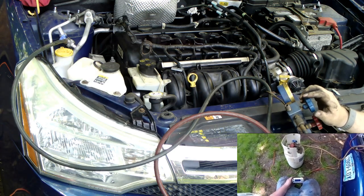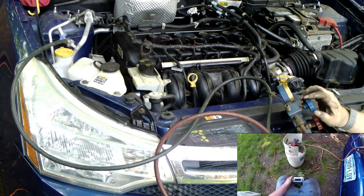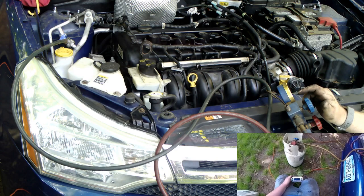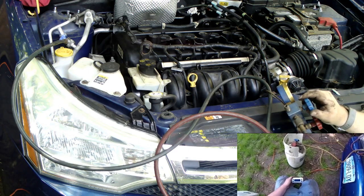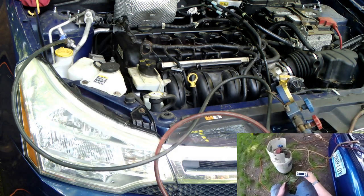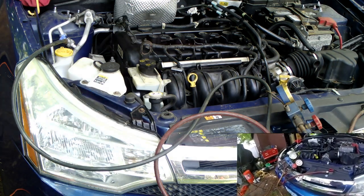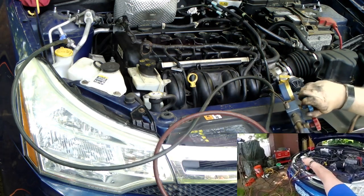It's flowing a lot faster now. It's because this tank's got a lot more gas in it. Nine, ten. There's 11. I close the valve. 11.8. Valve up a little bit. 12.7. And the valve just a hair. There we go. 13. That's 13 ounces right there. Ended up at 12.8. Go ahead and close this valve off. Take a look at our pressures. Got about 25 on the low, 230 on the high.